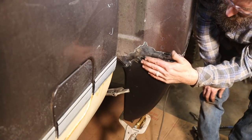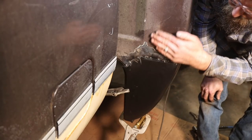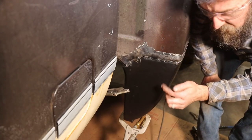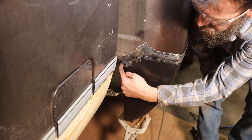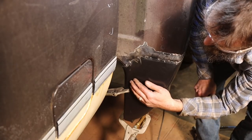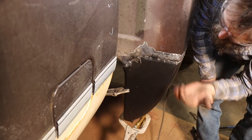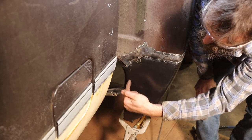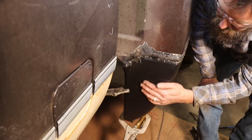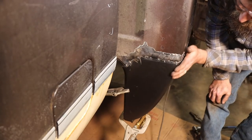I'd say I'm pretty pleased with the way I got that corner rounded. By the time it's welded, ground down, and hammered low, we'll have a dip that'll get filled with body filler for a smooth transition from the new panel to the old panel. Just to show you how poorly this panel fit — the seam should tie in evenly but it doesn't. This was probably more designed to cap over rather than butt up. But we'll just take a cutoff wheel, zip that in, and make it look like it's supposed to be that way — no one will know the difference. The bed covers it anyway, so if there's anything that looks a little out of the ordinary, I want it to be back there.